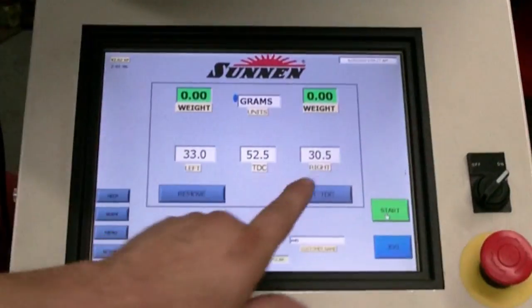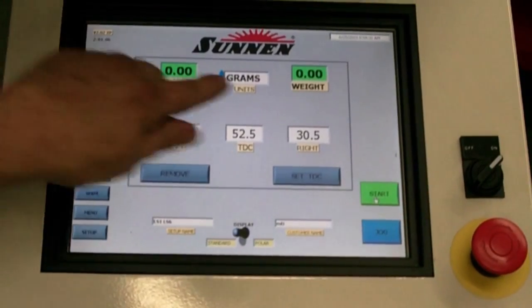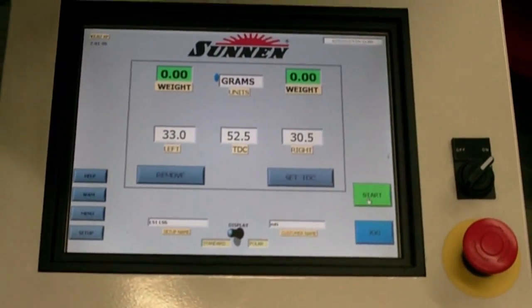It positions the crank exactly where it needs to be. These numbers here represent the position of your crankshaft where it needs more weight out or you need to add more weight to it. You can see this one is dead zero — so that's perfectly balanced, to a tenth of a gram. Until it hit my finger.